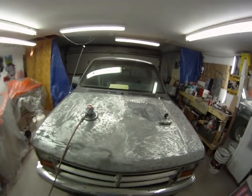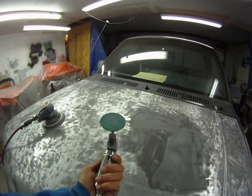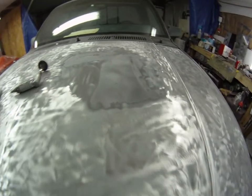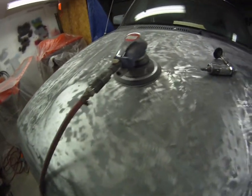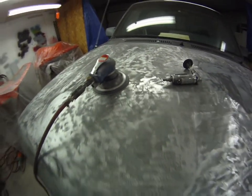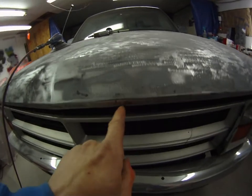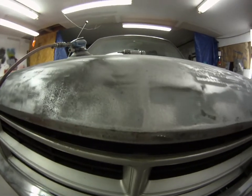Back to the piece of Dodge. I'm using my grinder with some 50-grit disc on it to get it off. I'm gonna go back over it with 80, and then I might go over it again with 180 before I prime it. I've got to treat all these spots with some one-step rust converter where it's rusty.